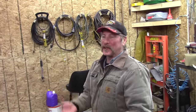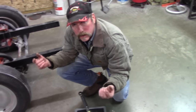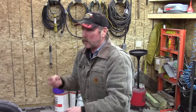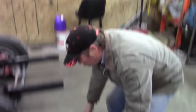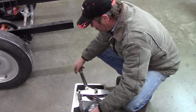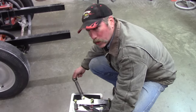You know what a differential cover is like? It's just a light piece of sheet metal. So 16 pounds is a lot of weight. These bars will not be total unsprung weight because they're connected to the frame. When they weigh a connecting rod, you don't just weigh the rod — you weigh the big end and the small end because they're both doing their own little circles. Probably about half this weight would be added to the rear end and the rest is supported by the frame. I'm gonna take these rods off — I would have had to have a bar anyway with two of these.